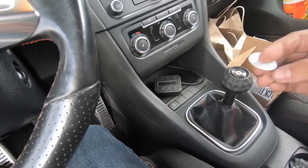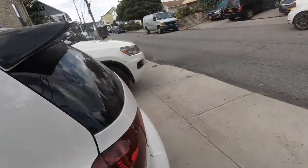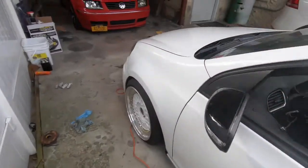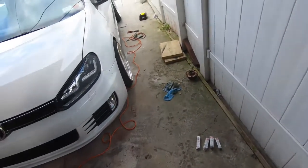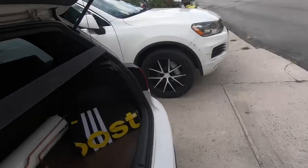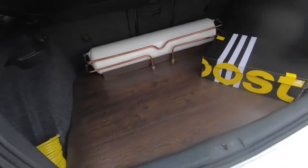Same installation process. Now we're gonna install the keys and we'll get ready. This car had a problem with the tank always being empty. I looked in all the lines, looked at all the bags — everything was fine. Last time I was here to do the front bags that were messed up. I took my time to see what's wrong. First problem was the water trap — it wasn't actually catching any water, it was letting it all stay in the tank.